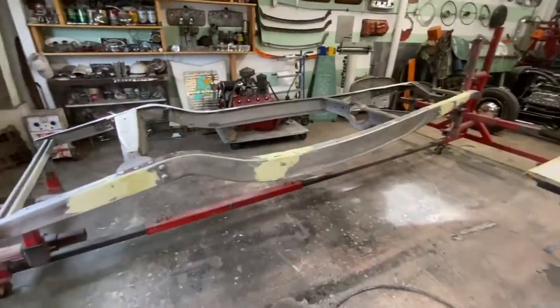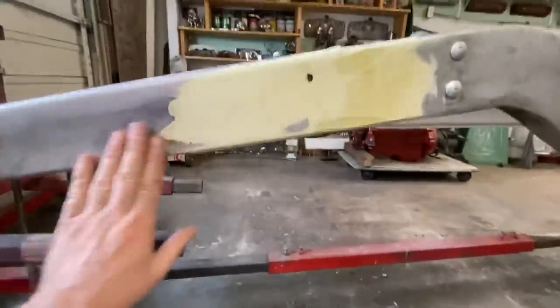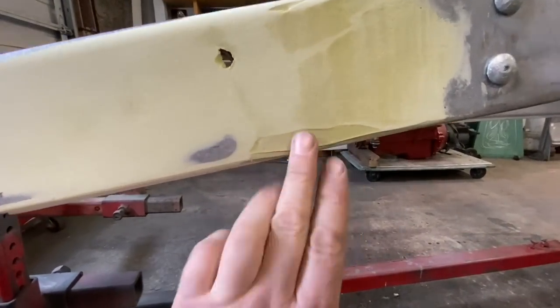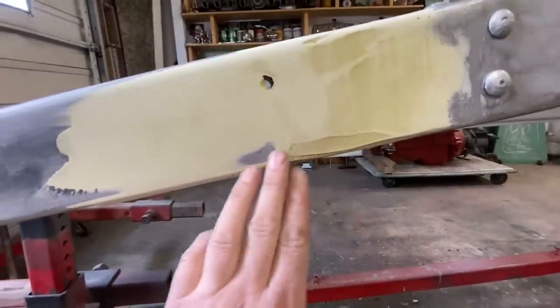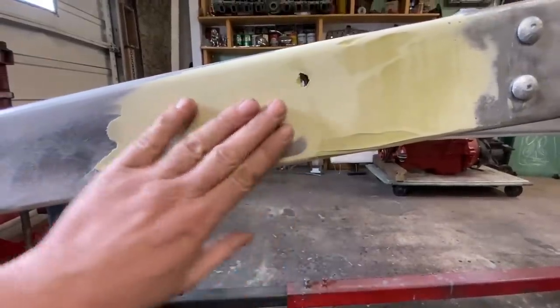We're back inside now. We sanded our first coat and we're ready to apply a second coat. On here, notice how we broke through to bare metal right here, but it's still rough here. The reason I did not keep sanding to sand this out is because we've hit bare metal here. This is the highest spot.